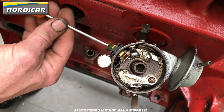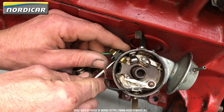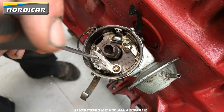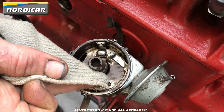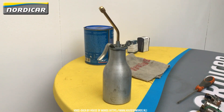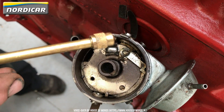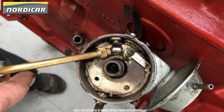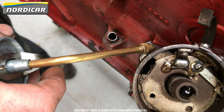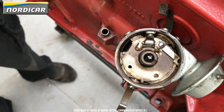We're now going to disassemble the capacitor and the breaker points. Next, we'll clean the axle with a cloth. Take the oil can and drip some oil on top of the distributor axle, the vacuum governor, the bearing on the base plate, and in the oil jar that lubricates the distributor axle. After that, we'll close the oil jar and with a cloth remove the excess oil.